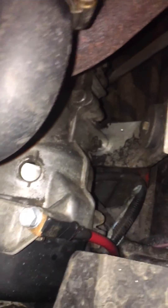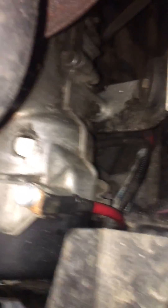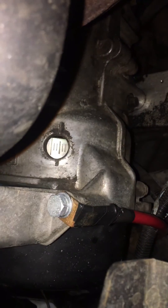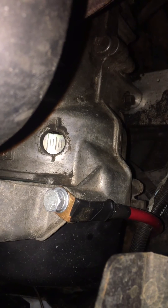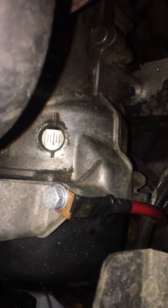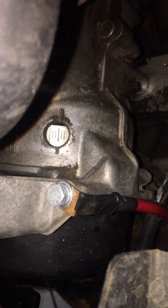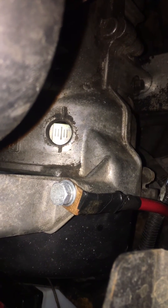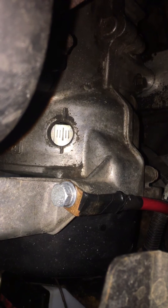Run your sled — mine's checked at 3000 RPM — and then point that light at the hole right there. Every time that spark plug fires, the light flashes, so all you see is that timing line right there. It doesn't look like it's moving because your eye isn't fast enough to pick it up. That's how you set your timing.